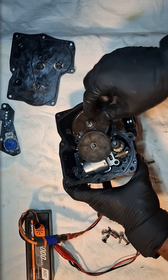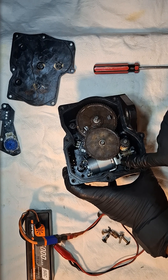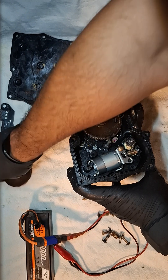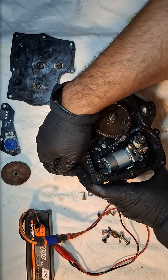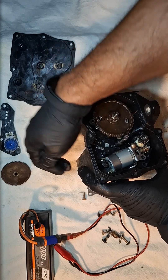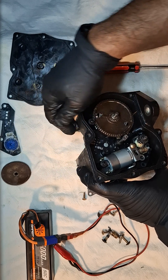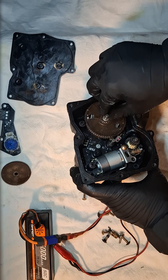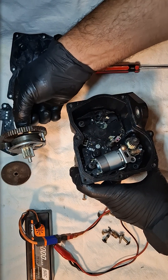Once open, you'll have the gearing and the top motor — that is the center lock. The main failures are two things: either the lower motor is dead or it's not spinning in the right direction, meaning the gearing is not engaged. I'll show you what happened in my case — it just keeps sending a false signal to your ECU. We're going to remove this gearing.